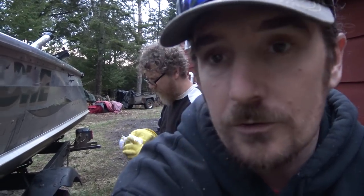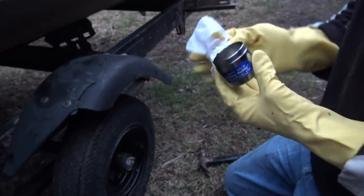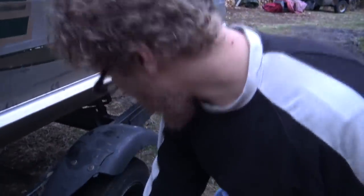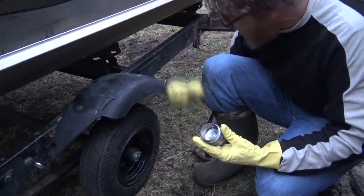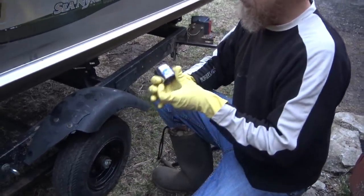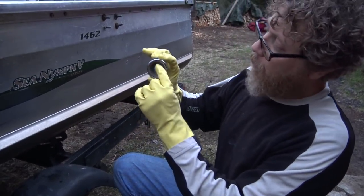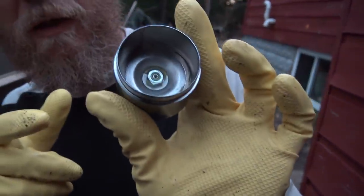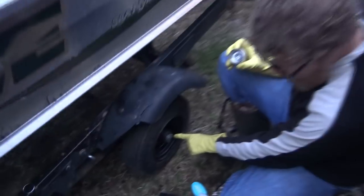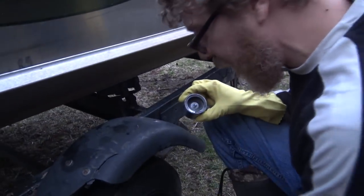We put on Steve's new motor and we are setting up some bearing buddies. I didn't know about these, but they're amazing — it's a little cap. I just redid the bearings on this trailer with my awesome neighbor Brian, who's a mechanic, because this is going to do some miles this year. Brand new bearings, new grease, new everything inside, new races — the whole deal. It's a cap with a little nipple on it, and with a grease gun — it's spring loaded — you shoot grease in on this side.